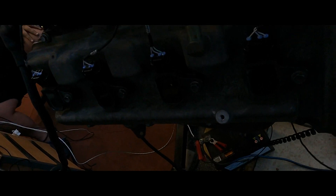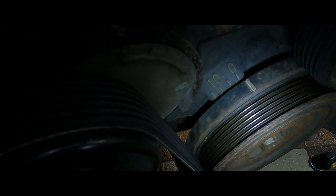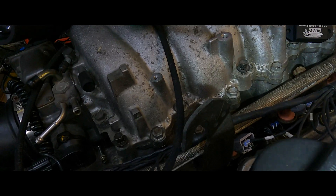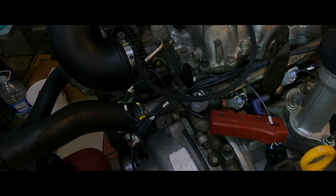Firing her up and revving to 3,000 RPM. As you could see, the whole time we were revving up the timing mark stayed on 10 degrees — consistent and smooth. We don't have to adjust those drift-compensation values. We went up to about 3,000 RPM and it was really consistent and straight all the way from idle through to 3,000 RPM, so we're happy with that.